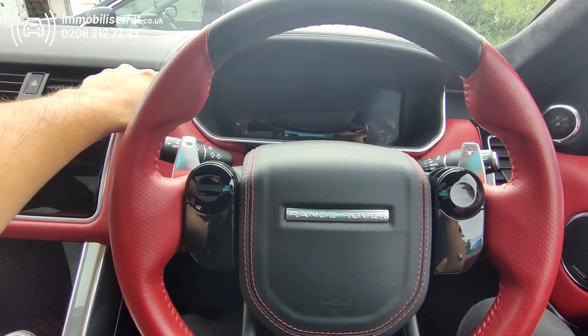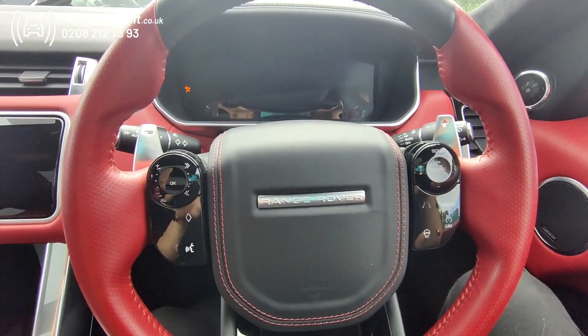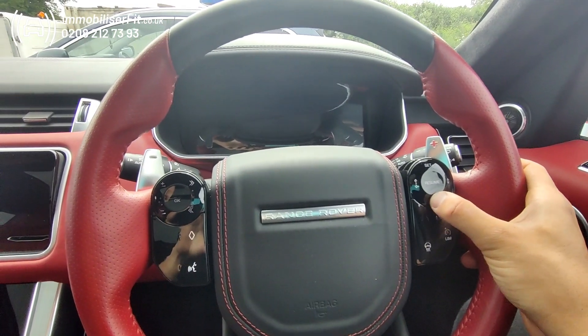Now in the vehicle, turn the ignition on without starting it — that means foot off the brake. Get the ignition on and then put in your disarm tone. Enter your disarm melody; one, two, three is our tone.